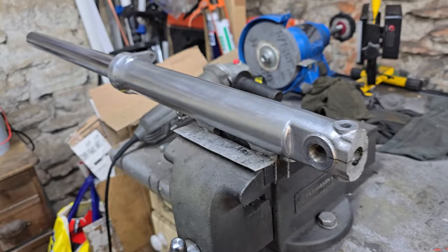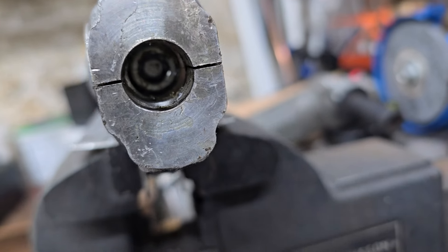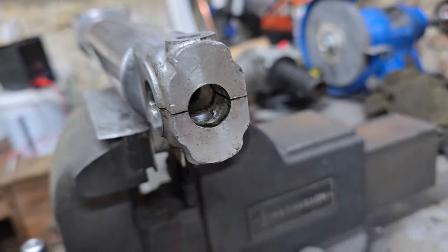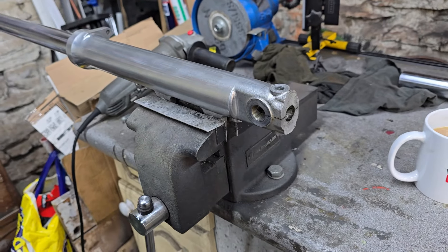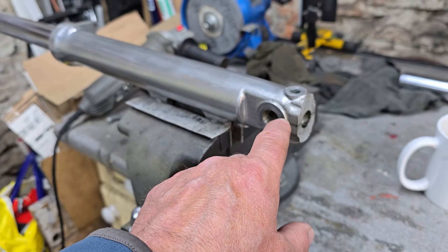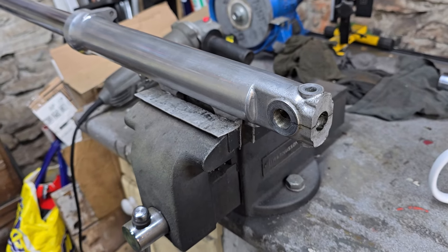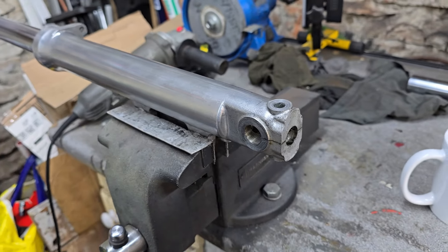They're slightly different in terms, but most of the time it's pretty straightforward. Usually at the end there is an allen bolt, and that bolt holds the damper rod in place. One of the most difficult things is trying to get that bolt undone because it'll either be done up extremely tight with thread-lock on it. When you try and undo it the damper rod will just spin and you'll be there all day.